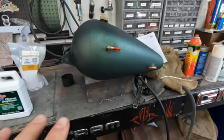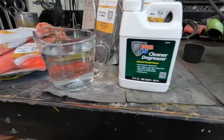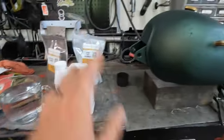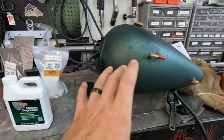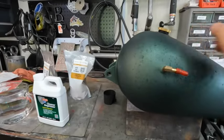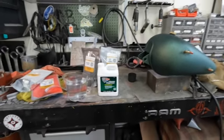Now that we have our tank thoroughly rinsed out, it's pretty much completely empty but it's not dry — and that's okay. The next step is the cleaner degreaser from POR-15. This is water-based, which is great. You could probably do this with any cleaner degreaser, but we're sticking with the kit. You have a quart of cleaner degreaser and a quart of warm water. Don't use super hot water in case you're using duct tape. Pour them inside the tank. If your tank was really rusty, you could throw in a piece of old chain, rocks, or BBs. You're going to shake and rotate the can for the next half hour before you drain and rinse it.